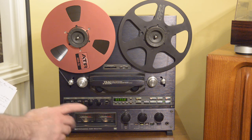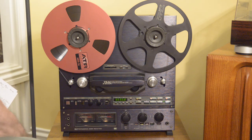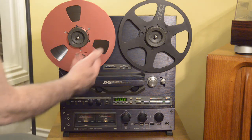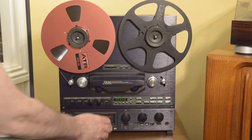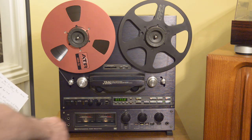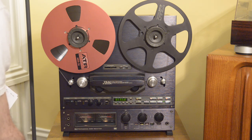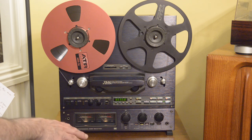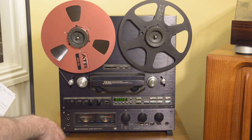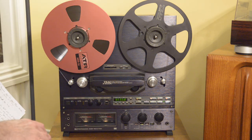I did set the levels. Put it into source and I'll just play the source for a minute. My levels could go a little higher — especially with a modern tape like this you can go higher than that. I usually hold them around mid-scale. That is the source. Let me get that back to the beginning. So my source is cued back to the beginning, levels are set well enough — we're in record mode. LH2 position. This deck has been calibrated for the LH2 position with this tape.